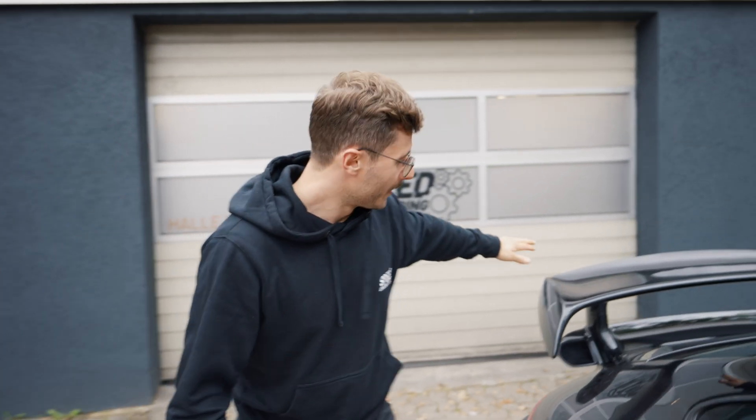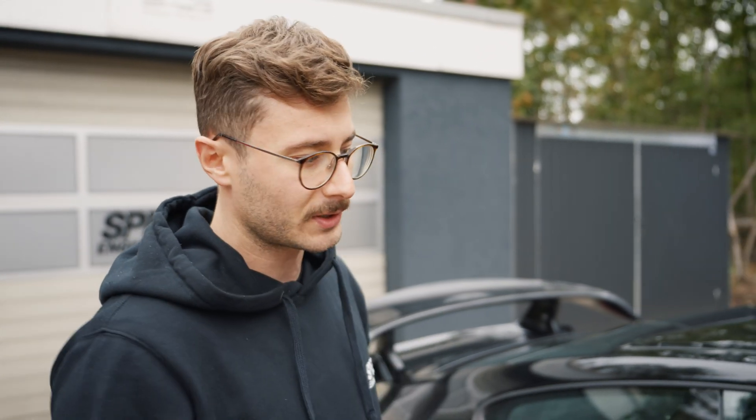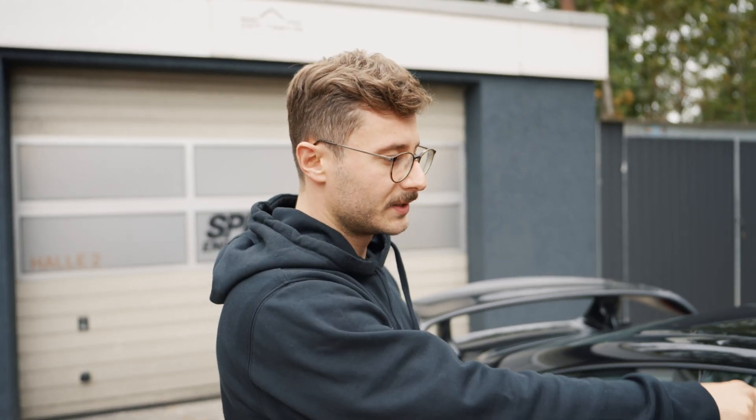The car is undriveable, but in the meantime I also want to show you a quick update on the EV conversion of our Series 1 BMW. While we are standing here, this GT2 already got an aero kit from us. The customer wanted this wing to be a little bit higher and also wanted another flap, which we designed and manufactured - it's a one-off production. Now he will get some Recaro Podium seats and the full package of sensor kits we are developing, which means that the OEM Porsche display will be removed and replaced with our own touch display with sensors for monitoring brake disc temperatures, differential oil temperature, and gearbox oil pressure.